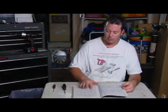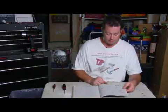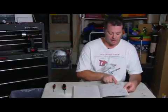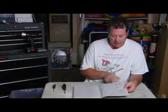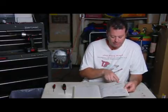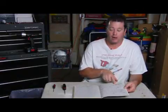Once you've determined what the symbols are and what each thing means, it's as simple as going back and looking at your diagram. There's going to be a wire color chart that gives you a breakdown of the different color wires and an abbreviation for each. You may think black and blue are both 'BL,' but they're not — the symbol for black is BLK and the symbol for blue is BLU. So you always want to make sure you look at your wire color chart and determine what abbreviation they use for the different color wires.